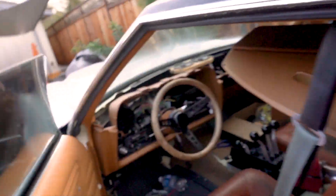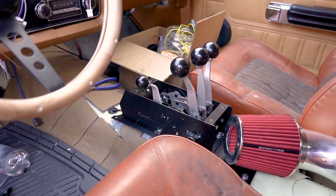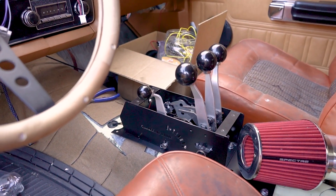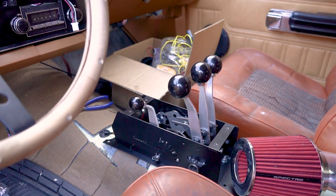What is up guys, it is Niles and this is my 1977 Ford LTD 2. I've been doing a lot of work on this car recently — we pulled out the original Ford 302 and we're swapping in a Ford 460. With that swap we have to go to the larger Ford C6 transmission, and when I was doing that swap I decided it's about time to upgrade from the original column shifter and install this floor shifter. This is a Hurst Off the Floor lightning rod shifter — I just loved how the lightning rods looked in the GM Cutlasses so I wanted to put that in this Ford.